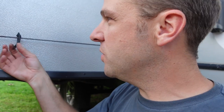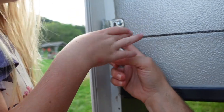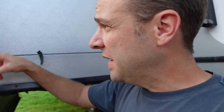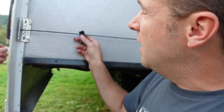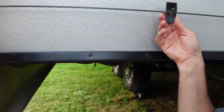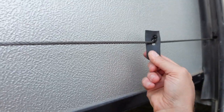It's chipping it off — that's not cool. What I wanted to show you is this looks like a point of wear with these cables. So check these out closely. If yours is starting to do something like this, a stopgap measure is to put some electrical tape around it so it will eat into the tape before it eats into the cable. I did that a few weeks ago and we've gotten a bunch of opens and closes with it. It looks like they have these rubber pieces and they glue them on there. If you see a rubber piece with a lot of holes in it like that, take a close look at how your slides are.